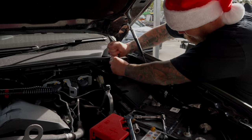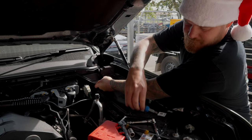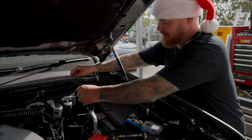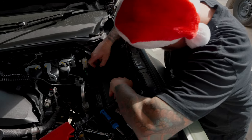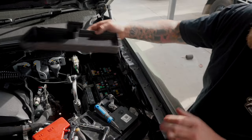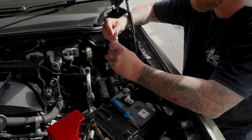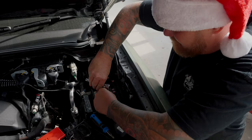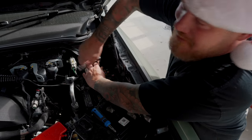Let's remove this out of the way to make life just that little bit easier. So we've got a couple of tabs here at the front and back. Pull this cover off. Now we've got three bolts in here — I thought these were 8mm but we actually need a 7mm. We're going to remove these three bolts entirely; they're long, painful, and annoying.